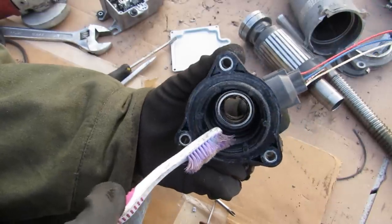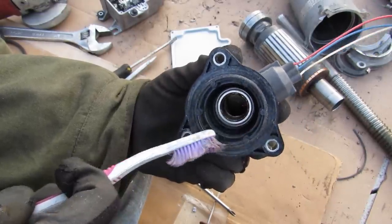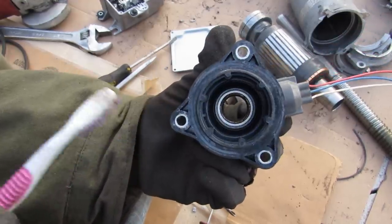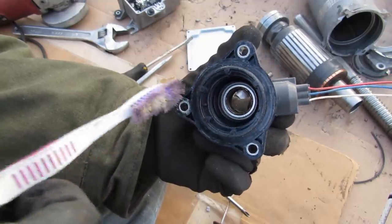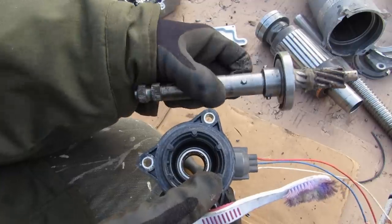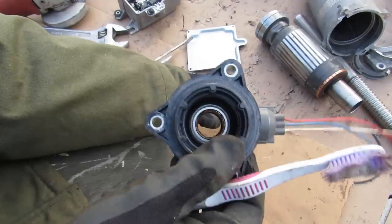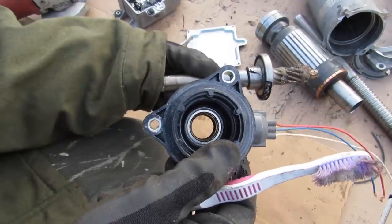It's important to know that this torque sensor only measures the driver's input in terms of how much force and speed is put on the steering wheel, as opposed to the actual position of it, which you would use in a stability control system for example. The electric power steering system is still a closed loop control system, because the driver still has a physical linkage through this shaft as to where the final position of the steering wheel is going to be. Once you stop turning it, the sensor stops sending a signal to the EPS computer, and it stops sending power to the motor.